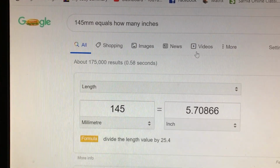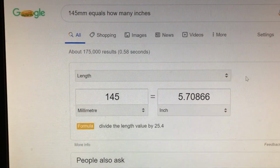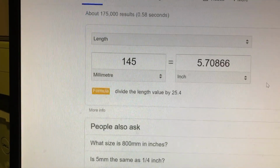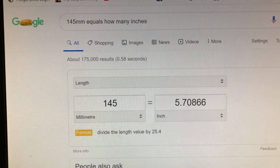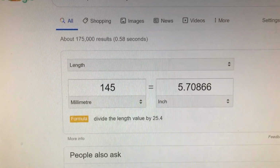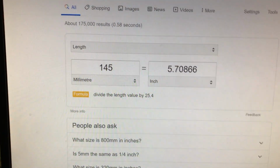Stock Norton is I think 3.2. I should look it up again. Pretty sure it's 3.2, and 27 to 28 degrees. So I'd like to keep it around the 3 or 3 1/4. I think that's what most Harleys are, like 3 1/4 inches of trail. But I'm going to show you on the board outside there. Just a minute.